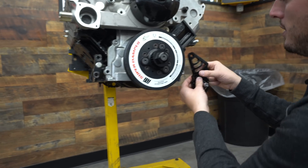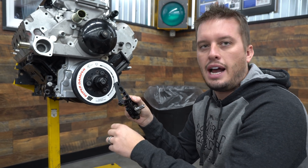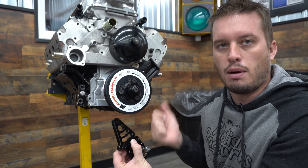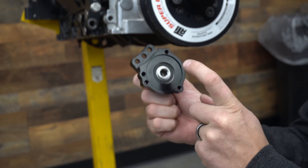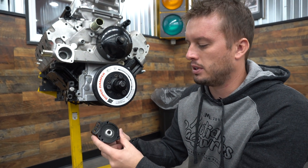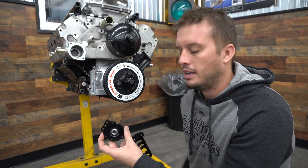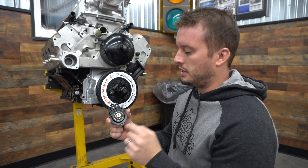You can turn it over and adjust it further. And while we're showing this on an LS, it actually has the same standard pattern all these brackets have always had — based off a small block Chevy / big block Chevy — so it'll bolt right in place in those applications too. You just need to space it correctly depending on your mandrel. Three bolts changes everything. It still has the 3/8 hex drive in the back, so you can adapt it to a hex drive style fuel pump, common for Waterman or Aeromotive. You can also bolt on the three-bolt adapter to switch it over to a cable drive without any other components — I'll put the link in the description.